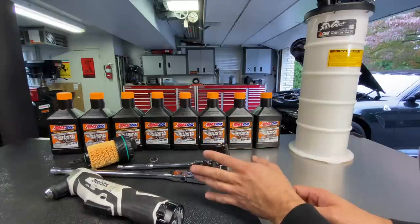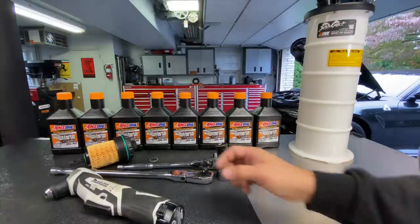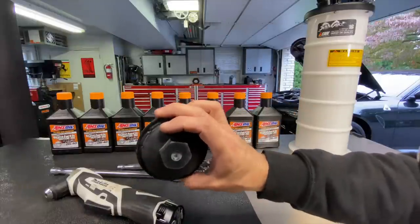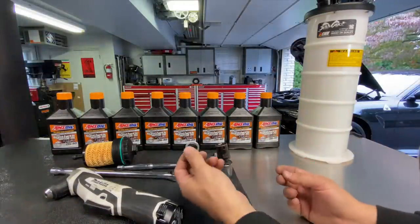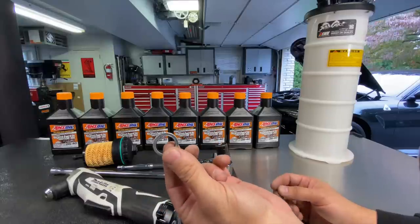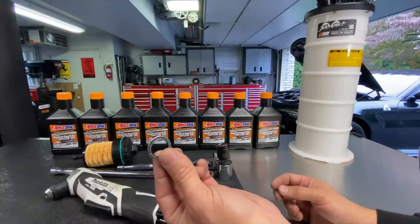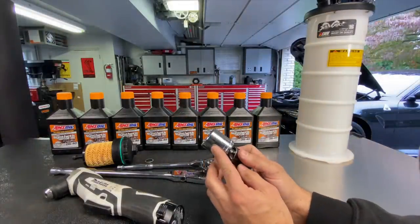We're in the second week of October, so I do oil changes on all of my cars this time of year. You're going to need an OEM oil filter assembly — you can buy this from Mopar online, from Centerline Alfa, or your local Alfa Romeo dealer. These are about 80 to 95 bucks. Also, if you're going to drain the oil from below, you're going to need a brand new crush washer — these are specific to the Alfa Romeo and you won't find them at a local NAPA, so get them from the dealer.